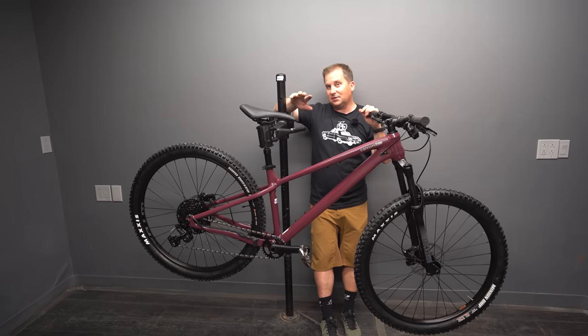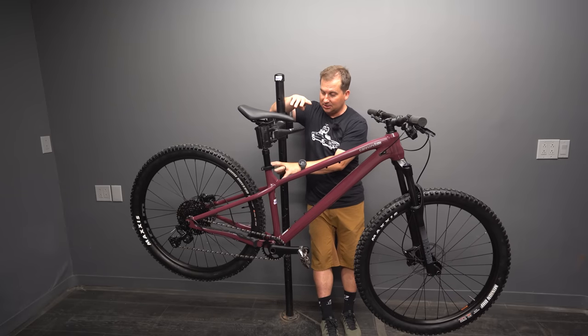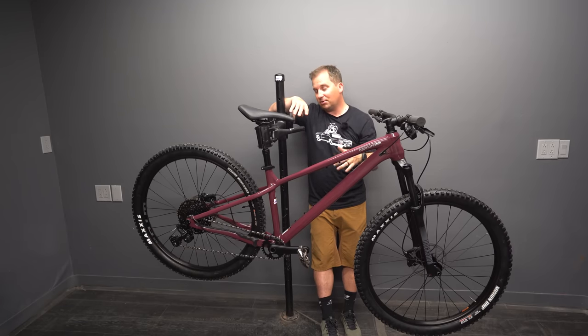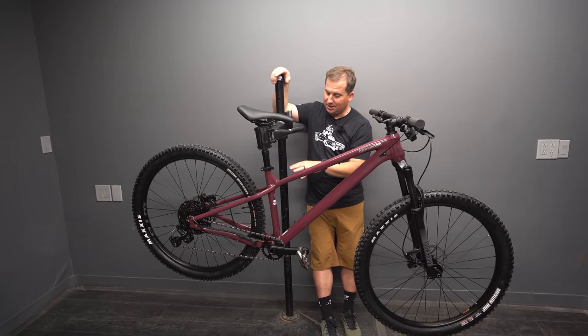I love the price, $1,500, and even that Habit 3 still has the same frame, same through axle. Most companies cheap out, and when they go to the lower end frame, it's got that quick release axle. We don't want that, especially on hardtails. It's nice to see a through axle here.